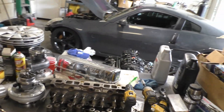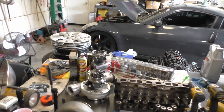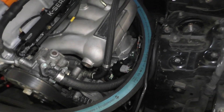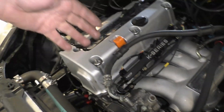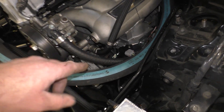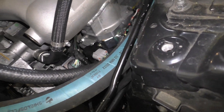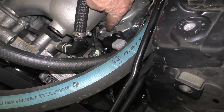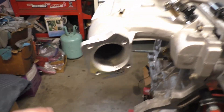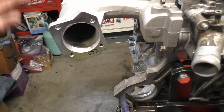I've got the tune kind of nailed down — the idle sort of nailed down. The problem with this car is, to fit the intake in the car, he had to hack it off from the back because this is a rear-wheel drive. I was fighting with this because I didn't know that this intake — he just cut it off and then welded it down here. Me not knowing that that hole wasn't there created a whole lot of problems under closed loop idle control. I don't know if these eBay intakes are still available — I bought this one about a year and a half ago.